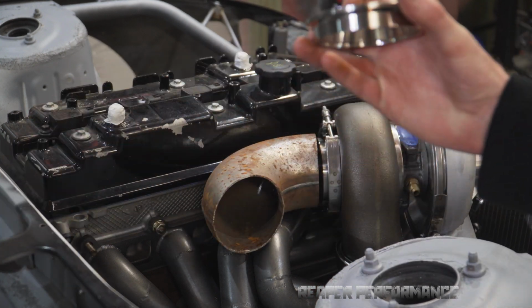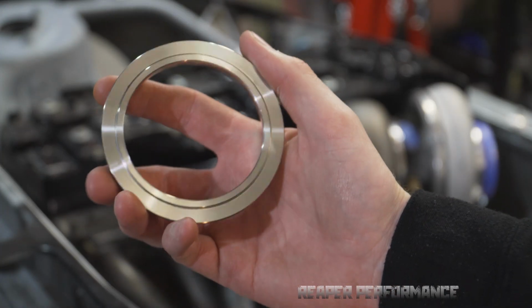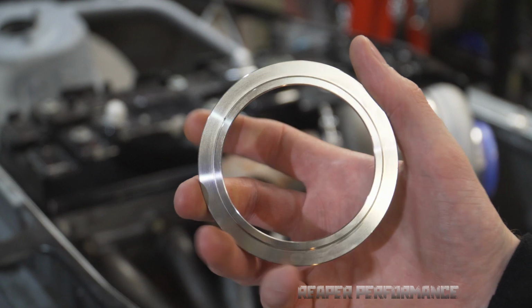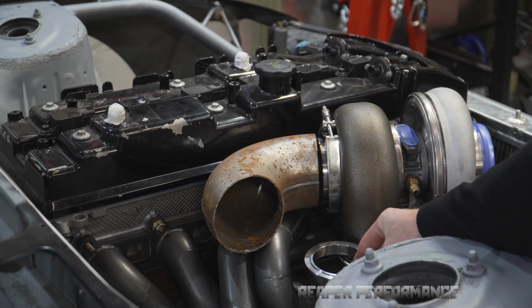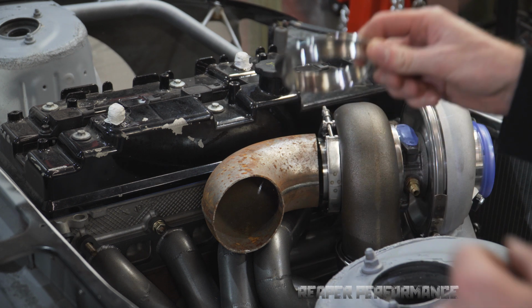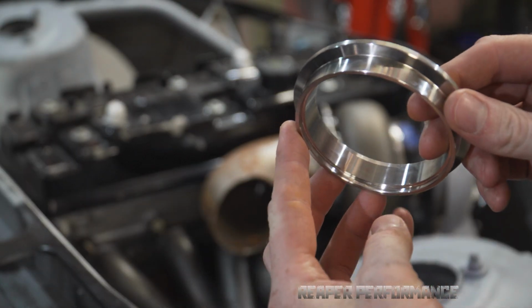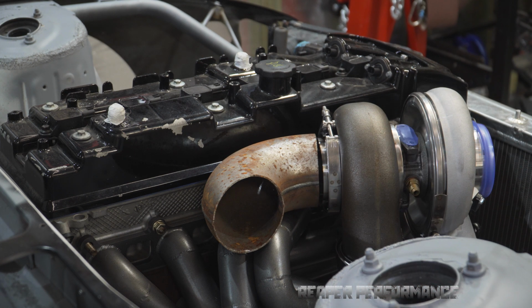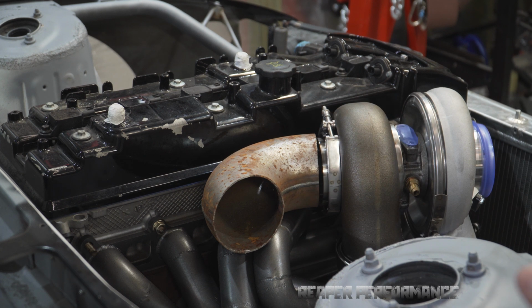So what we've actually got is the flange that came with the turbo to mount onto a manifold. It's the same as what's already on there, but luckily we've got a spare. So I'm actually going to use that, if we have a look at the bottom of the turbo, I'm going to basically just be welding that straight onto the manifold, and that should give us an extra close to 20mm higher on the turbo for the thickness of that, and that should give us that bit of clearance there to the manifold. So first thing we've got to do, pull this thing off, manifold off, and we'll start cutting it apart.